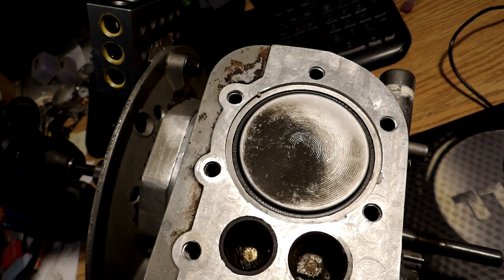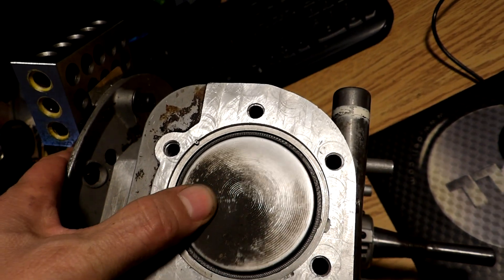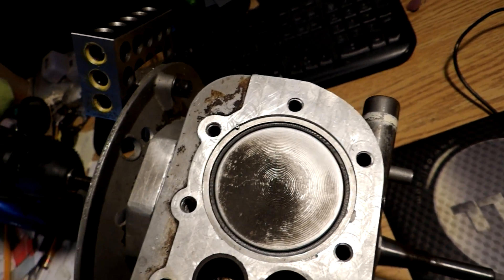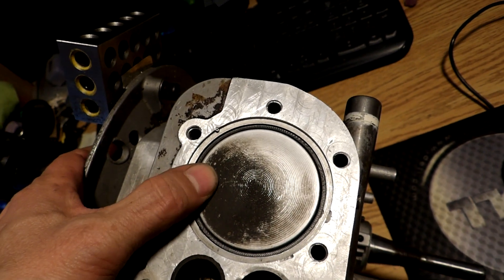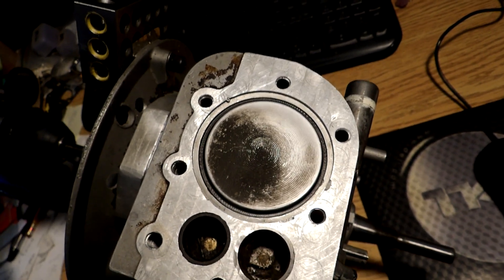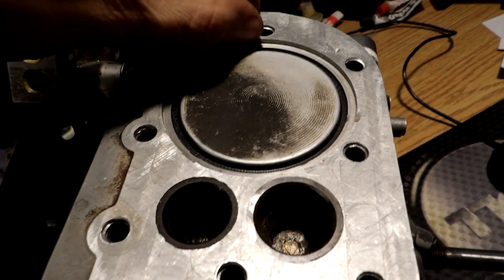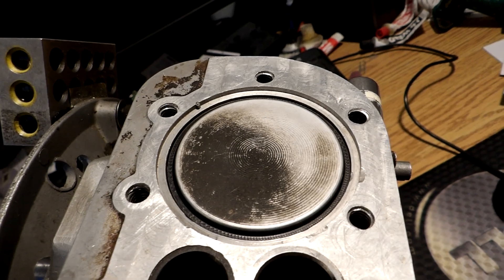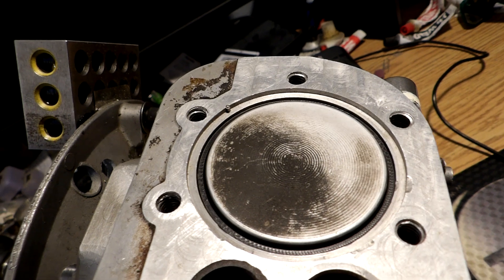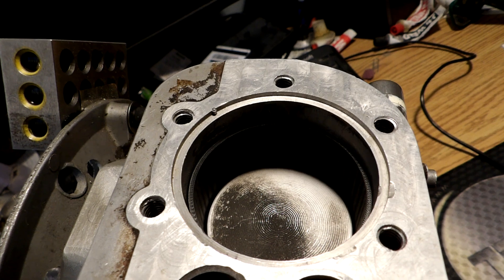I've still got to fabricate the steel sleeve. As you can see, the piston has slop in it — that's because it needs to run a 30 thou over piston and this is a stock size, but it's a good demonstrator. Other than that, it's dimensionally correct height-wise. Ideally this notch shouldn't be in the block — that's from use as a four-stroke sleeve valve where we tried to put a contracting ring on the outside of the sleeve. Couldn't do it at the bottom where it needed to be, so we tried the top and that didn't work out so well.